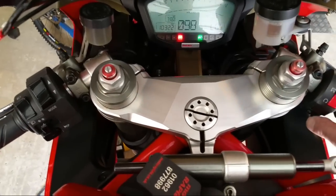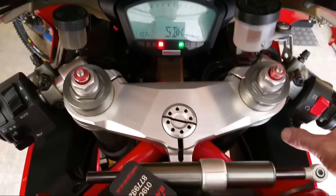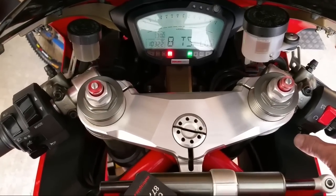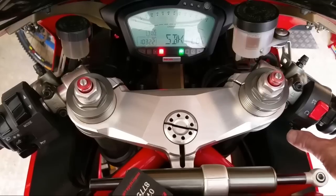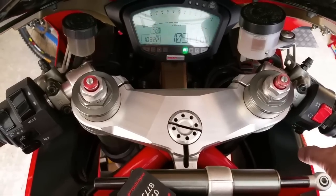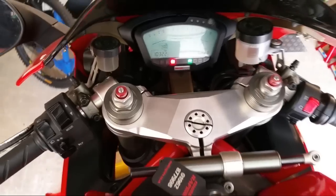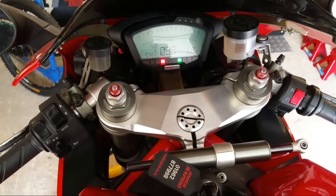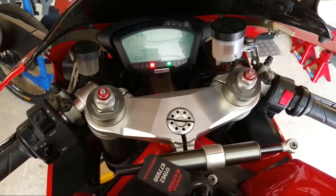What's happening is if you listen carefully, you can hear the starter motor rather than the engine turning over, and you can hear the compression. Between compression strokes, you can hear the starter motor freewheeling. That sort of whizzing sound - that's basically the starter motor freewheeling. I'll get the new bits on the bench and explain what's going on with it.